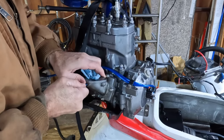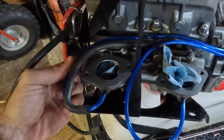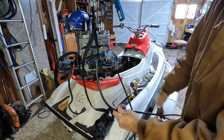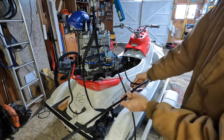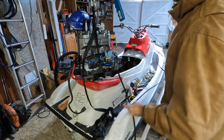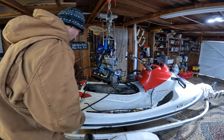Oh yeah, there we go — one line, two lines. I've gone ahead and put this fuel line on here. I just don't trust this original line. Here it is bent the correct way so it will attach here and come around the jet ski. I don't see any leaks here but I imagine it's brittle as well. I'm hoping this fuel line will work just as well. All right, I think it's time to lower this engine back in the machine.